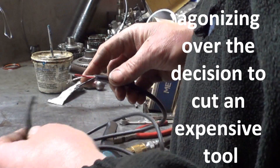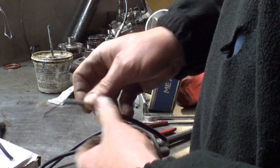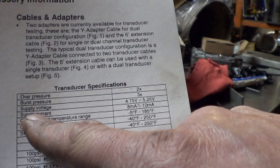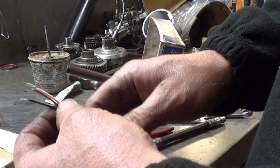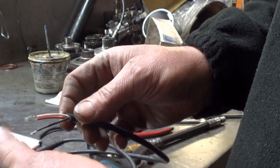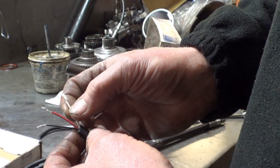I've been looking at this and it took me a while to make this decision, but I went ahead and cut it. After I cut it I stripped these wires, and when I read across this it did say 5 volts — and the spec does say supply voltage 4.75 to 5 volts. I'm kind of an electronic hobbyist, and I'm pretty sure I could take a 9-volt battery, use a little electronic regulator, regulate it down to 5 volts and run this off of it. That's probably what I'm going to have to do. I'm a little concerned with which of these wires is going to be power, ground, and signal return.